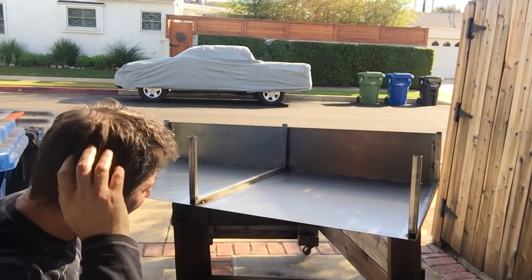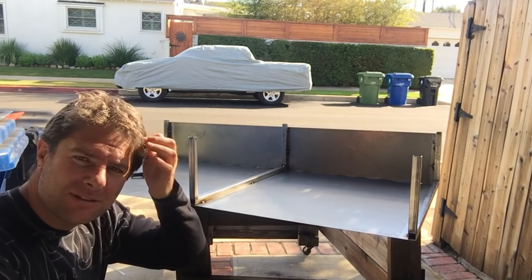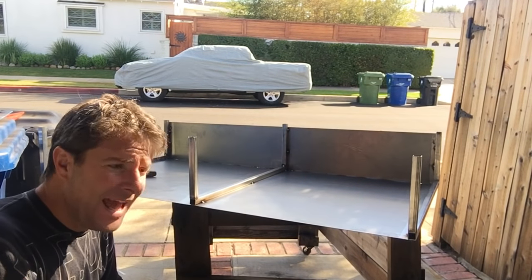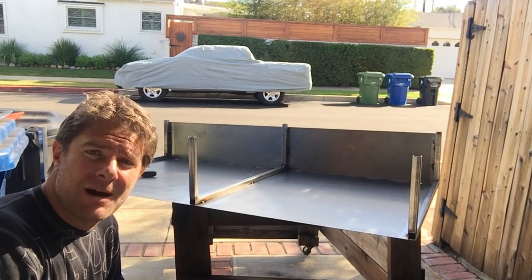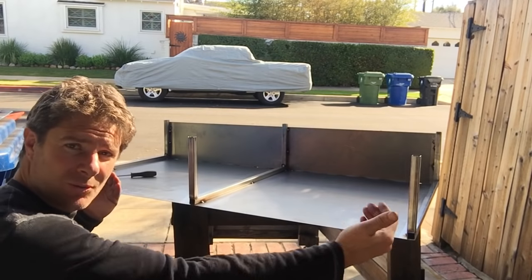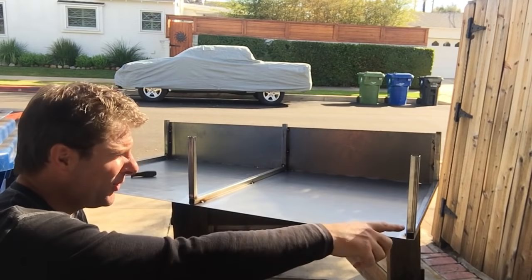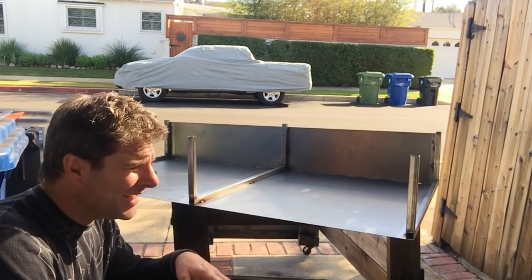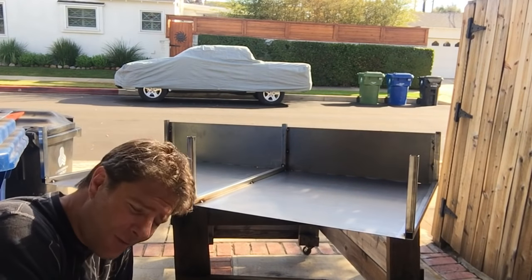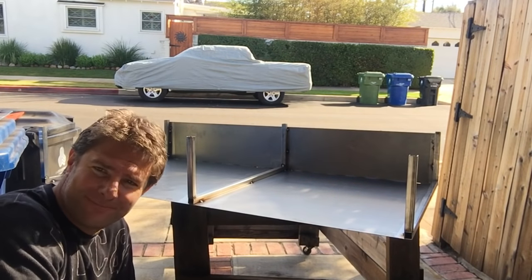So, what happened was, I made a measurement on the steel, and then I thought, well, I'll give myself an extra half inch. Now, I then inadvertently took a measurement from one line on one side, and one line on the other, which was half an inch difference. So when I actually folded it and then put the framework inside, it was a half inch out, and the folds and the cuts had been made by that point, so there was no going back. So we have one fold on one side and a lot of welding practice on this side. Happy days.